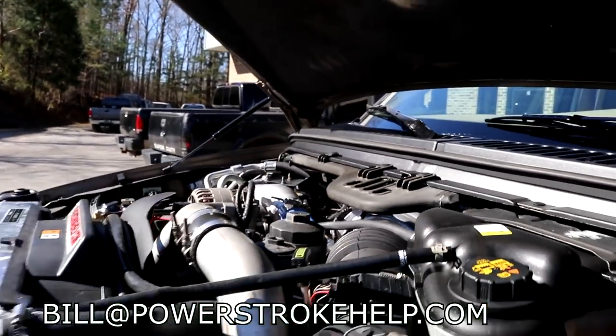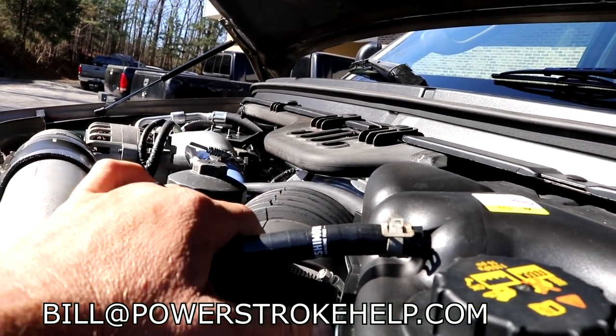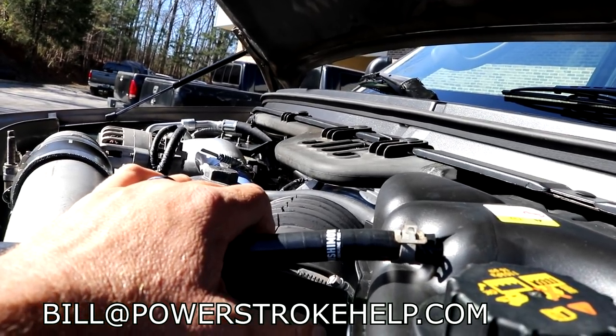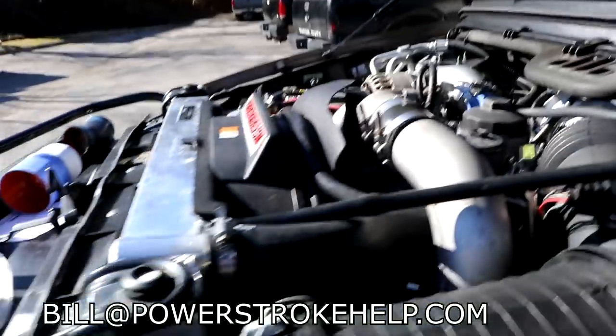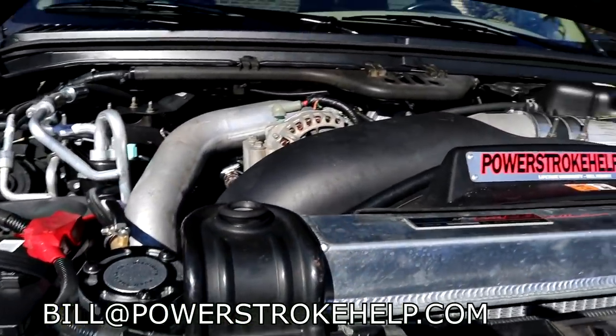As a result, you get some oil. And this is part of the problem. At this point, because of this ventilation system, this suction, you do get some oil. It's a very minimal amount of oil. You'll never see it move on your dipstick, but it gets sucked through the turbo and then put into this charge air cooler. And it'll actually accumulate some down in the bottom of the intercooler.